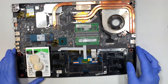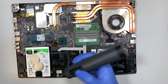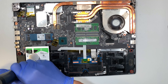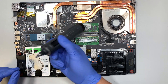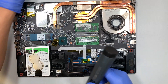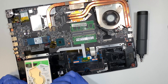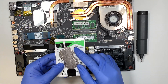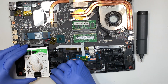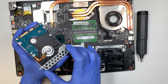Let's move on. Once we remove the battery, let's disconnect the secondary drive. It's a regular Phillips screw — I'm using an electric screwdriver. Once you remove the two screws you can slide out the secondary drive. If you want to upgrade to 2TB, 4TB, 8TB, or 12TB, you can do that by removing another two screws at the bottom and transferring to the larger hard drive.